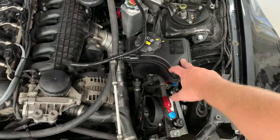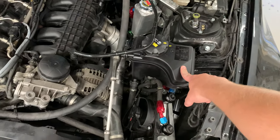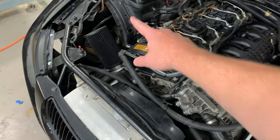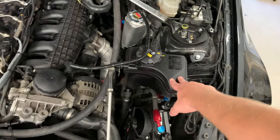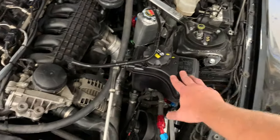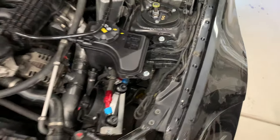This is a pretty common adjustment when you go single turbo. The coolant tank is typically over on this side, but because we run single turbo it's a little tight over in this area. We converted over to the 335D coolant tank — that's a popular swap. We've got it all hard mounted in with the body here.